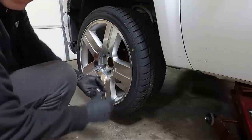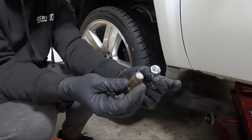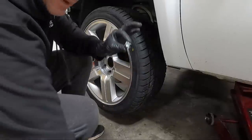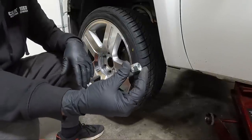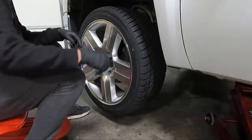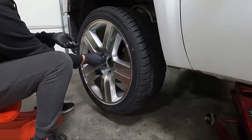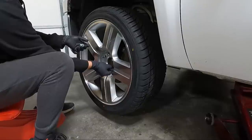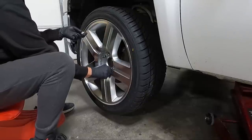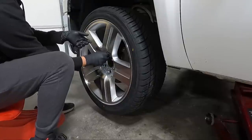Pretty standard fitting for these trucks. For the lug nuts — look at the difference in height. In the past when I've run these wheels and tried to use the factory lug nuts, the center cap won't go in. So I'm using an open-ended lug nut because our studs don't extend to a problem point. I picked these up off Amazon — they're open-ended M14 by 1.5, which is the factory size on these trucks. It also needs to be the same 60-degree acorn-style fitment. I'll snug them down and then set the truck down for torquing. I generally don't like to hammer down with my impact — I'd rather use the torque wrench.